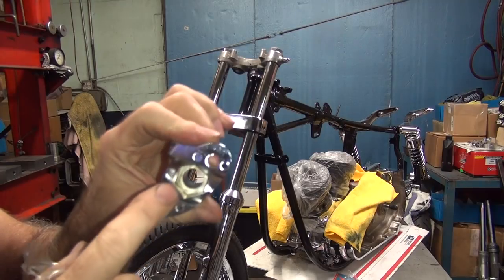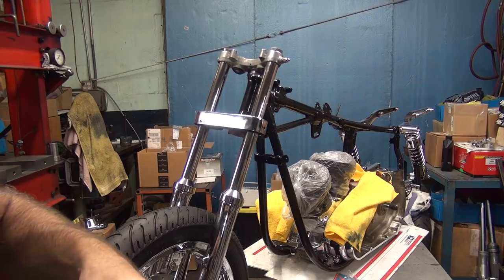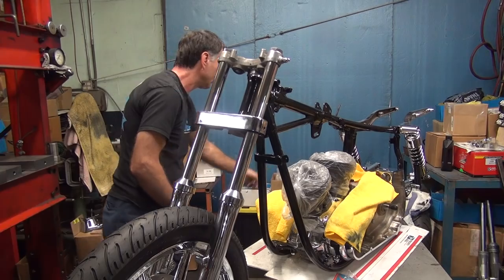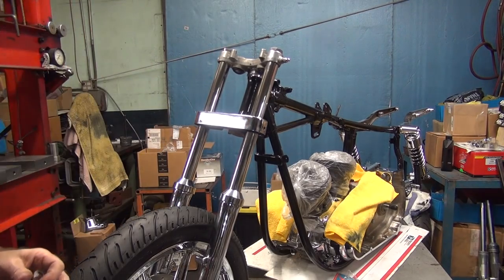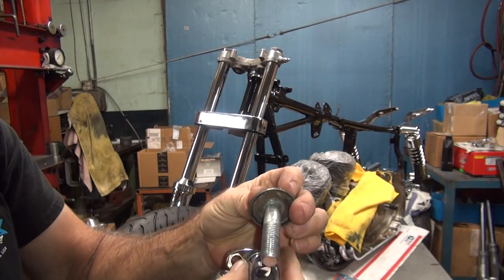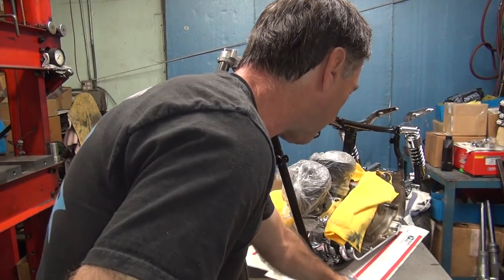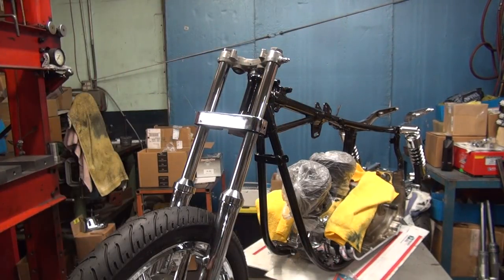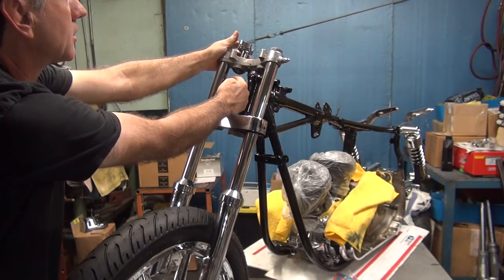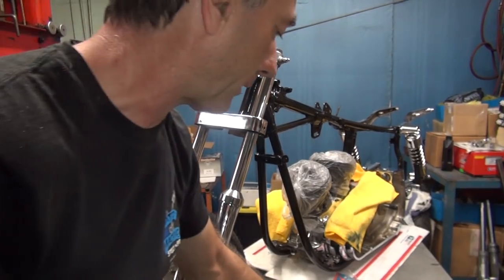Okay, you stick a through bolt. See the hex head in there? That means a bolt goes through. Not an Allen bolt either, hex head. These hex heads screwed in from the bottom, so they're going to be too short. They wouldn't be long enough to go all the way through the tree. So we'll have to get some longer ones to make that work. So that looks like a bolt about that long, which is about 4 inches probably. Get some 4-inch long half-inch bolts.